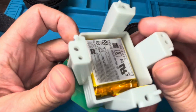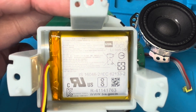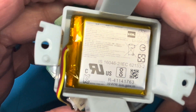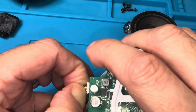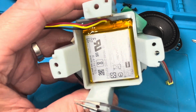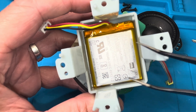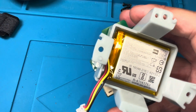Right underneath the driver we are going to see the battery. The battery is glued into position — let me zoom in so you can see the model number. A replacement battery is available online and I'll post the link in the video description. When you remove the battery, disconnect it first from the PCB, and be really careful when prying it out. It's best to do this when the battery is completely discharged, because prying these out is very difficult and you can damage the battery to the point where it's in danger of catching fire.